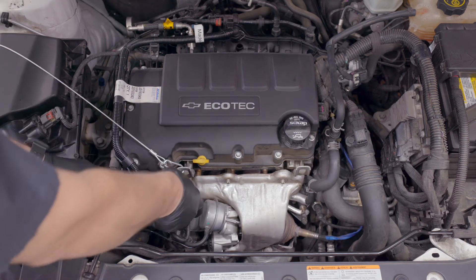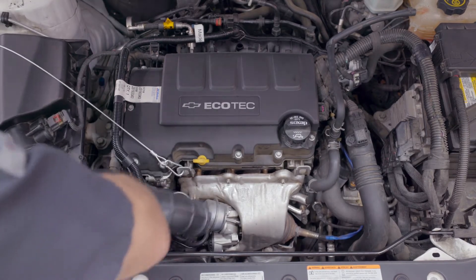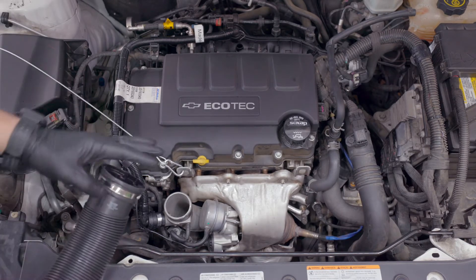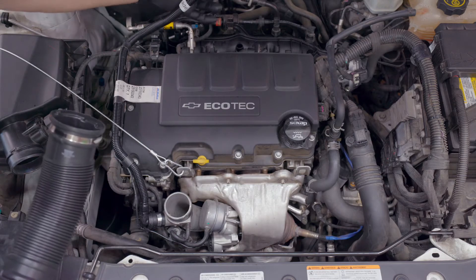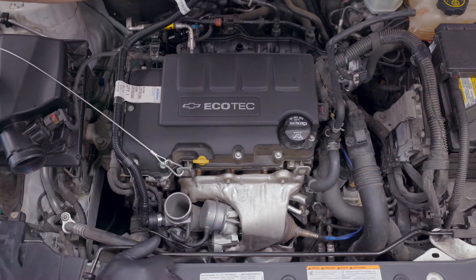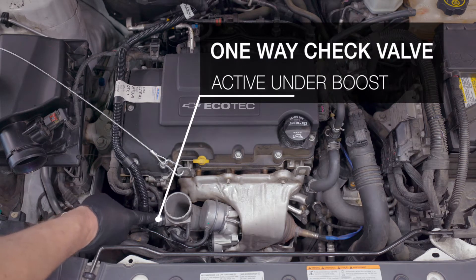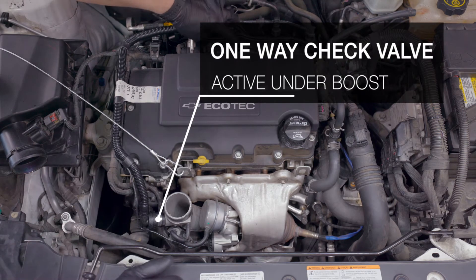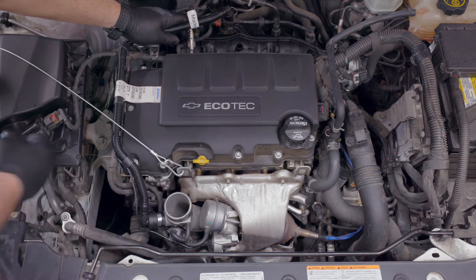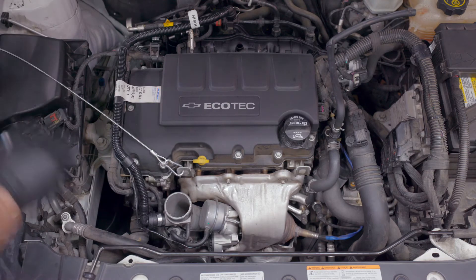To further illustrate this, if we remove this inlet hose off the turbo — if you find that you've added pressure through this duct and you have smoke or flow coming out of this valve here, a couple of things you want to do. This valve is actually located right here at this inlet and it's designed to close on a negative pressure. So when the engine's running, we have a negative pressure here and it will pull this valve closed. So when you run the machine where you're running pressure here against that, you may have some leakage here.